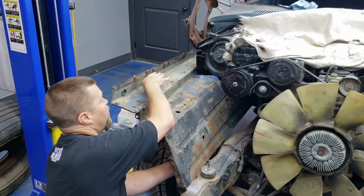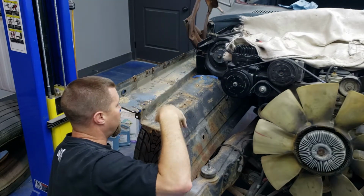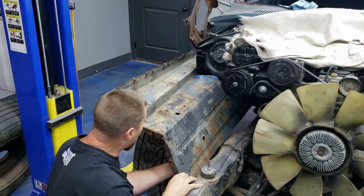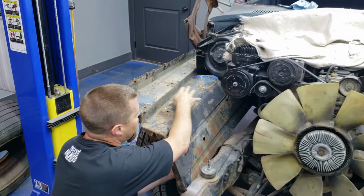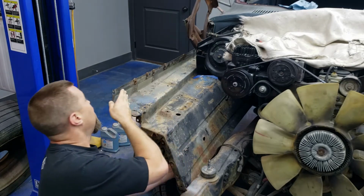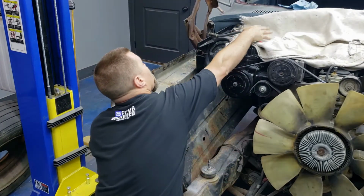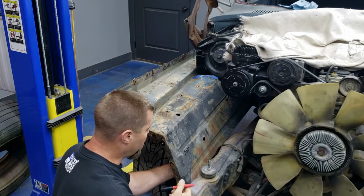Because if I look down this line right now, my wheel liner, or I don't know, inner wheel well is actually coming up. It's actually running uphill. So if I let it down a little bit, that's about where we should be sitting. And all my airbox and everything is clear right there. But it's got to come in some. So I'm going to make a mark here with my marker. We're going to have to cut some of this out to get a look at that.